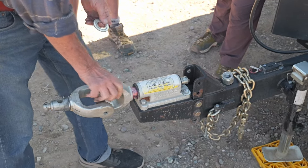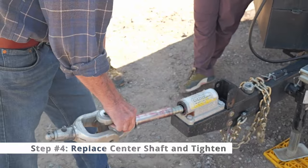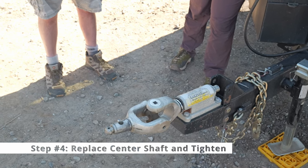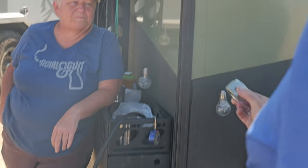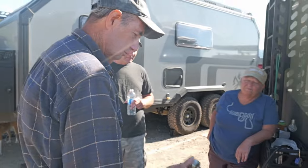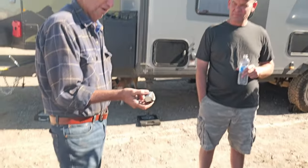Pretty simple, right? There's a washer in there. It's got a nylock nut — that's one style of a locking nut. It's not quite enough to rely on completely, so it's also got the set screw. And it's got the cotter pin in there, which doesn't hold it in its torqued position but keeps it from coming clear off. Yeah — three levels of security.